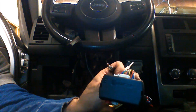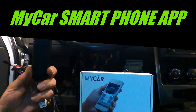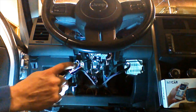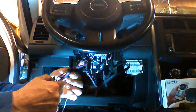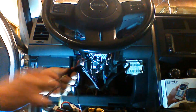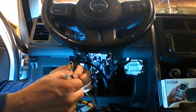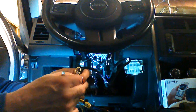I'm going to move on to the MyCar. I'm going to install the MyCar smartphone controller. The installation is very similar to the RF antenna kits. Again, we're going to locate the 4-pin data plug with a clip on it, taped to our harness. We're going to take the MyCar harness, and we have an adapter that will allow you to plug the MyCar directly into the plug with a clip on it on the T-harness.